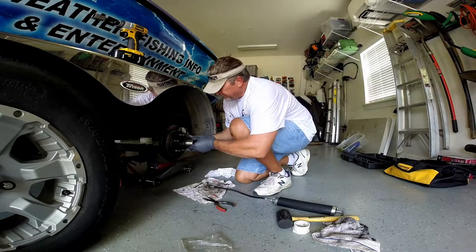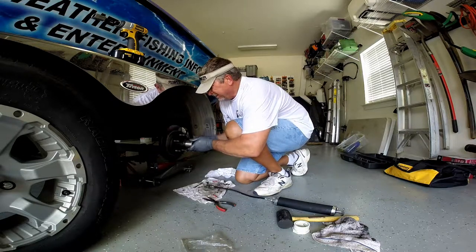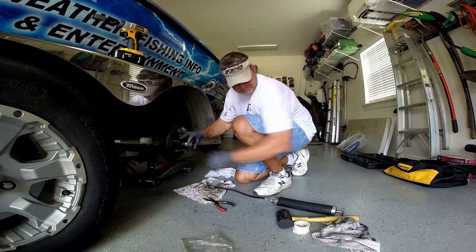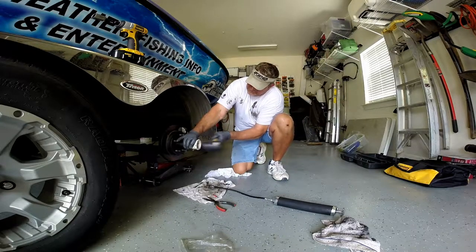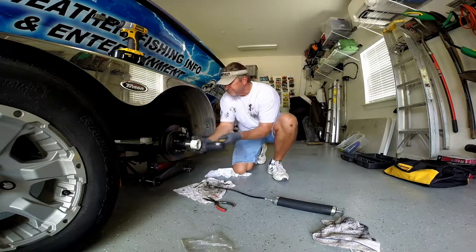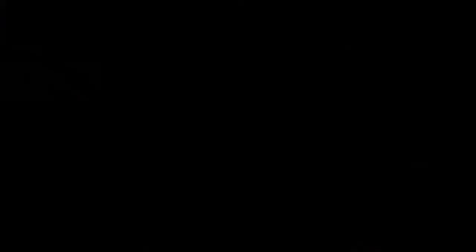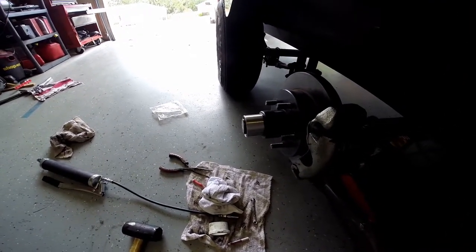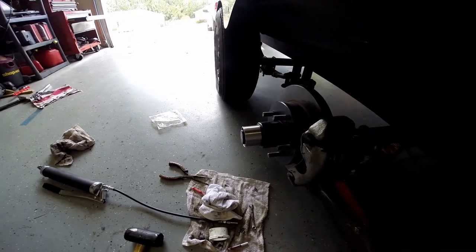Okay, the loctite's on. Just press it in here, sit it in here — and chances are there's going to be grease that splatters because this is a pressurized system. Take our PVC adapter to tap it in. And now that it's tapped in, you can see that the center button is pushed out partway, indicating that it's pressurized. And now we are good to go to put the tire on and roll down the road.